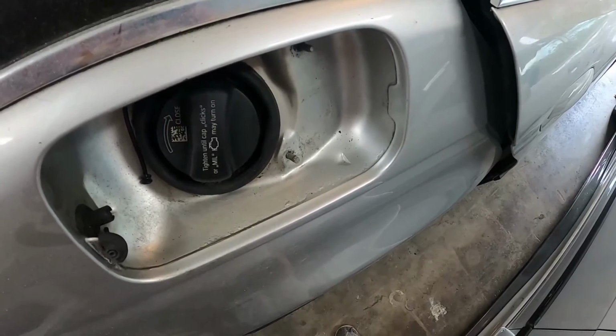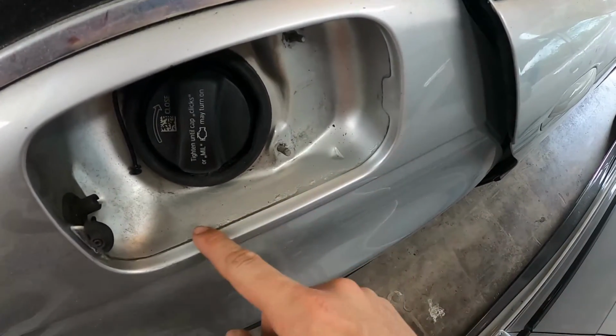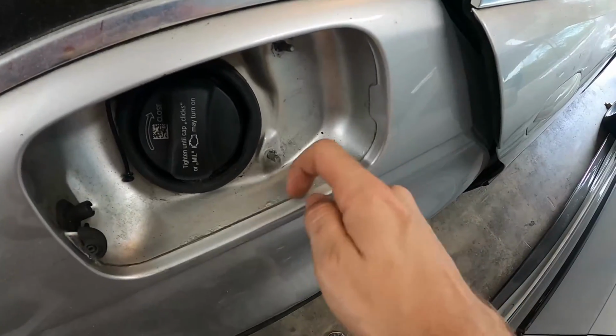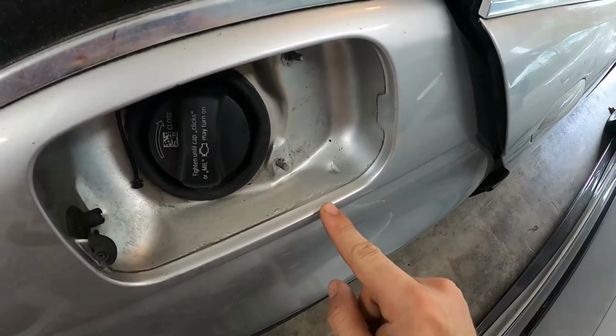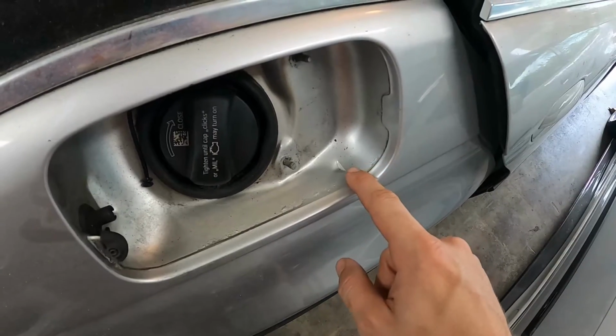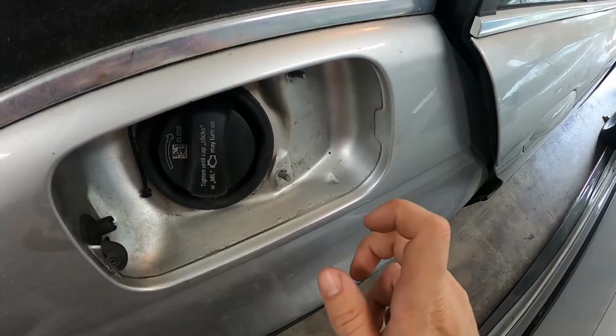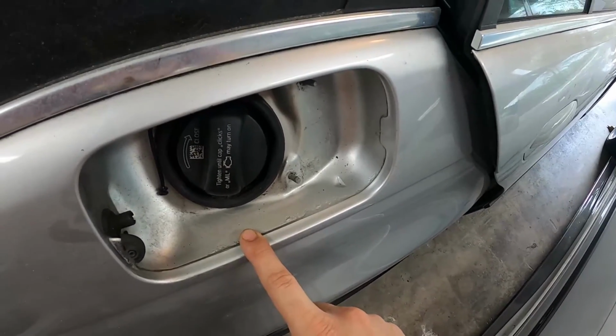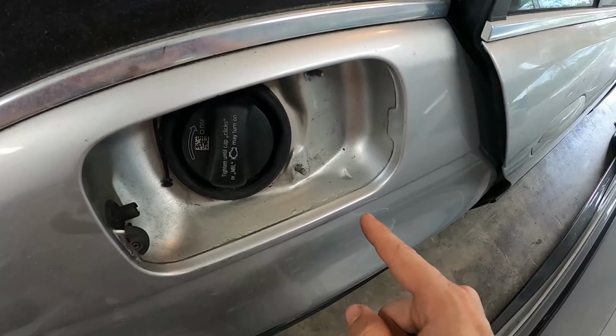And so, a better look on the Titan Silver car, you can see that it hasn't yet come above the paint, but is definitely bubbling under there. And so if we were to scratch this off or use a grinding wheel, we'd find the rust, and eventually we would need to get through the rust, spray on a metal etcher and primer, and then seal it with original paint and clear coat. So we'll be showing you how to fix this in a later video.